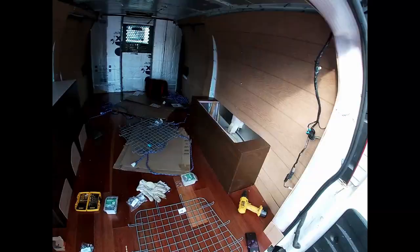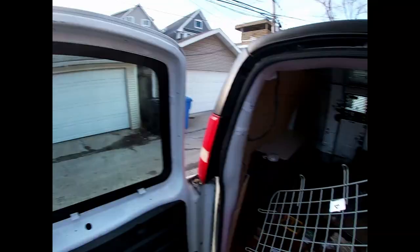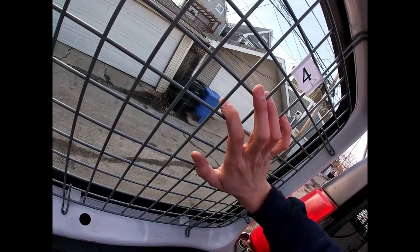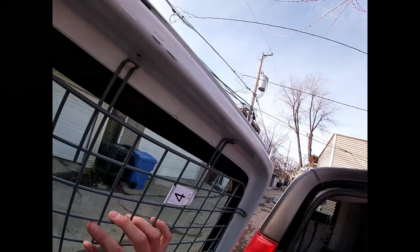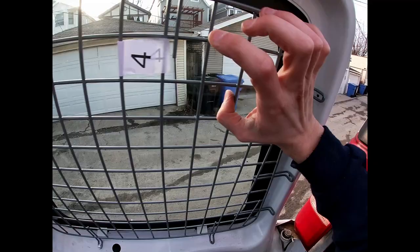Once done with the pilot holes, switch attachments and get onto the actual self-tapping screws and installing the window screen. Throw the screen in again really tight, make sure you're in the right spots, and go ahead and drill them in nice and slow. If you don't go slow you might strip the wall and then your screw heads will spin — that means they might come out eventually. Going back, I would probably use some plus nuts or riv nuts to really lock them in; it's a little bit of a hassle but necessary in some cases. I'm leaving it as-is because there are enough attachment points that it'll stay in, and if a screw does come out I'll put a bigger one in later. In the future if things start rattling I might throw in some lock washers for that extra grip.